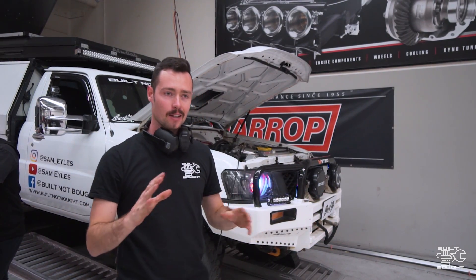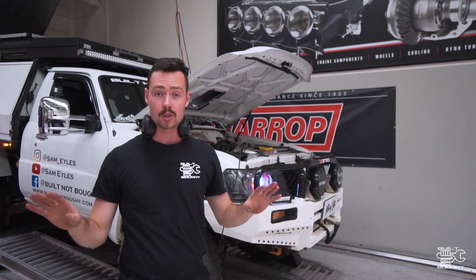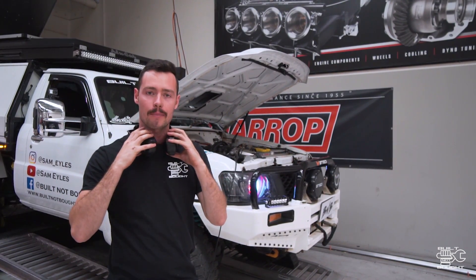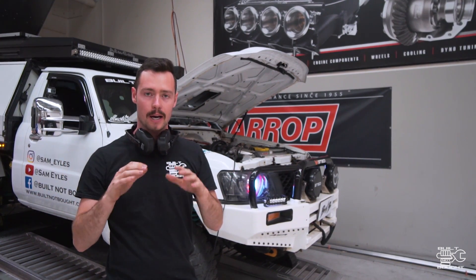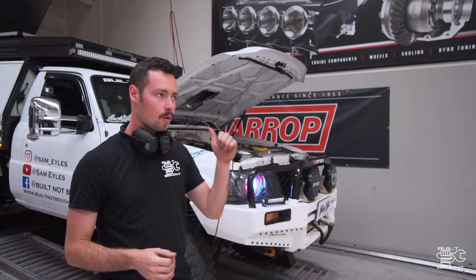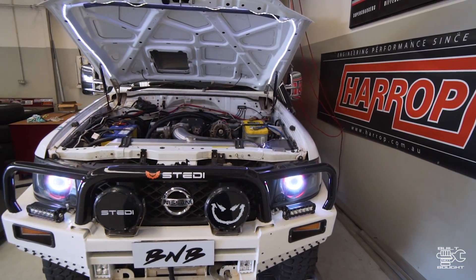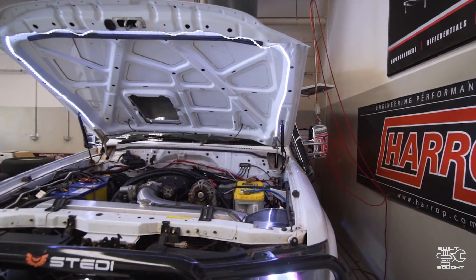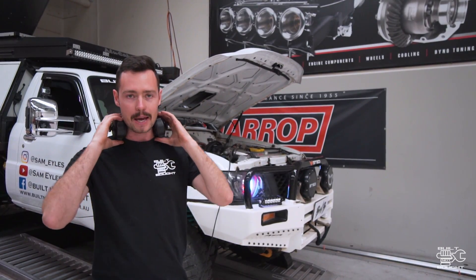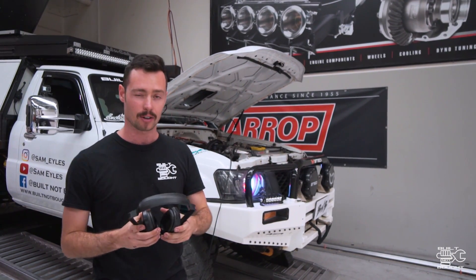Alright guys, so the first pull has been done. It looks like not a lot needs to be changed — a few little tweaks here and there — but the actual air-fuel ratio the whole way through is quite good. Gained a little bit of power, it's really about 456 horsepower on that one, so a little bit up there — another 20-25 horsepower from the last tune. Dynos are different, but it is definitely some sort of increase. We'll give it another proper power run now, and then I want to do a second one with the airbox cover on, because some people have been speculating that it's restricting airflow. I want to try and bust that myth and see if it actually affects the power.